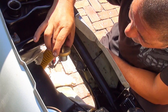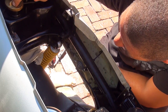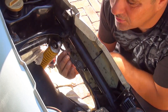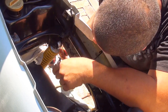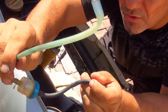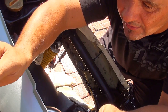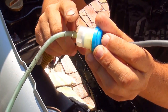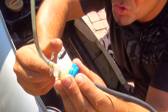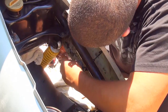Put the fuel cap back on so you don't lose it or get fuel in your eyes. Now pull out the old hose along with the old filter. You can see that hoses become harder over time — they lose flexibility and start to leak at the filter connection because they lose the squeezing power. So at this point we're replacing these old lines.